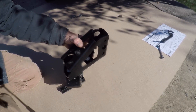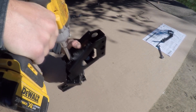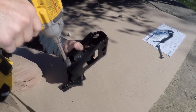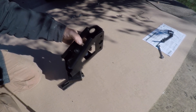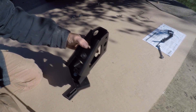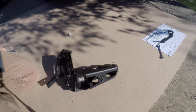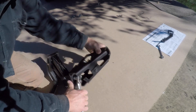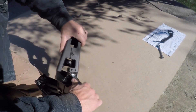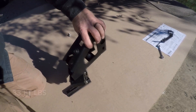To speed things up I'm going to use an impact driver. If you do decide to use one, don't over-torque the bolts and strip them out. I went ahead and used one without hitting it too hard. These two bolts get torqued down to 33 foot-pounds of torque.